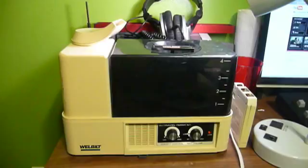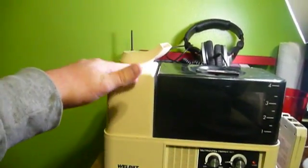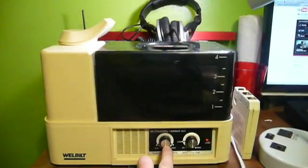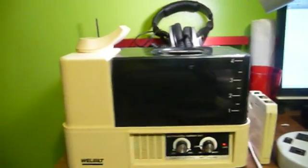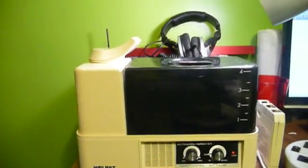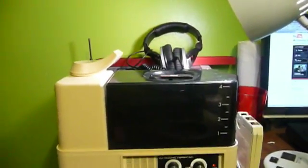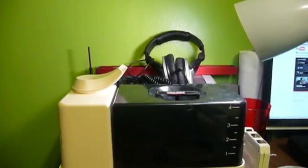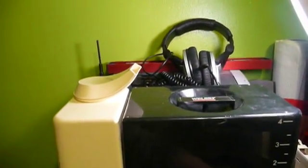So let's put it back together. The unit's back together and working now. When everything's been reassembled, the little fan pushes air up through the vent stack, and you have this little thing up top that you can turn to point the humidity where you'd like. All that's left is to set the humidistat accordingly and figure out how much mist volume you want. The mist volume is likened to a volume control on a stereo receiver — the higher it's turned up, the stronger the signal fed to the amplification circuit that drives the ultrasonic transducer. I've set a lamp up here to make the humidifying effect more obvious.